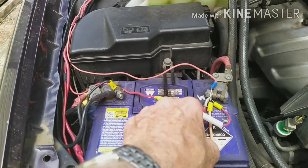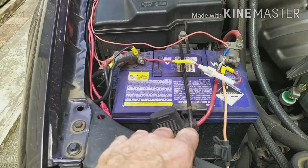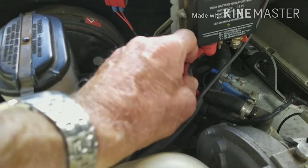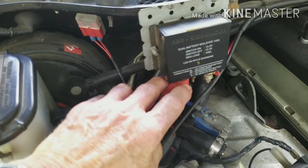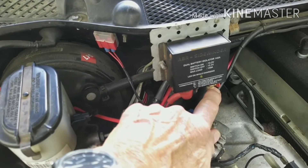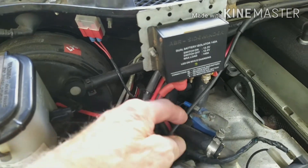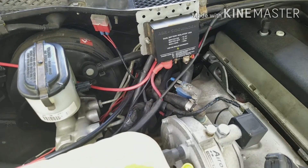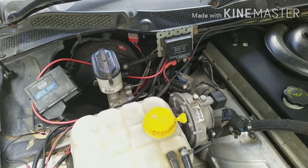Now the booster receives its power from the car's alternator through the battery through heavy duty cables, through the voltage regulator, and then it goes to the rear of the vehicle and is connected to an Anderson plug which plugs into the caravan and powers the booster. The new circuit will start here at the voltage regulator and run into the boot — that's where the solar generator will be located. It will be connected by Anderson plugs and the negative lead will run back to the starter battery in the car.